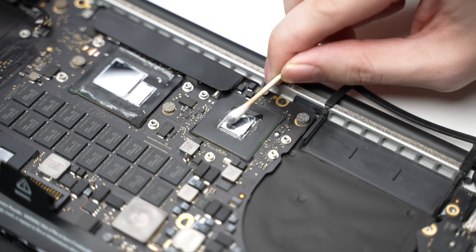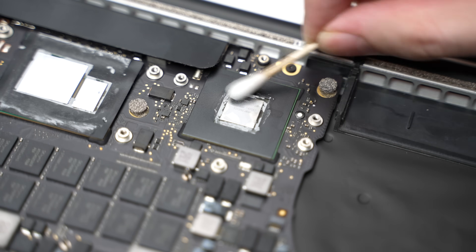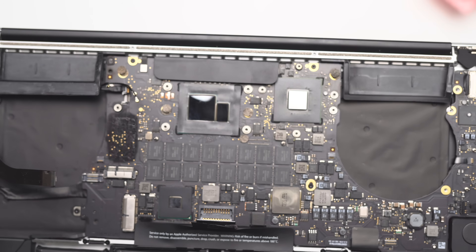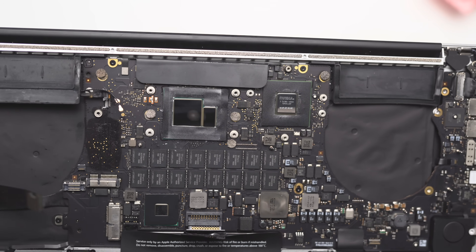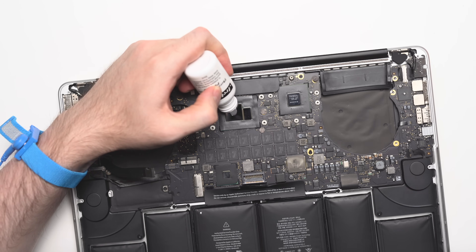About 2cm to the right of this chip, you can see the Nvidia GeForce GT750M GPU — it even has the little Nvidia logo on it. After a few minutes of cleaning, they were both nice and shiny, so I hit them and also the heat pipe with some Arctic Clean to prep the surface for thermal paste.